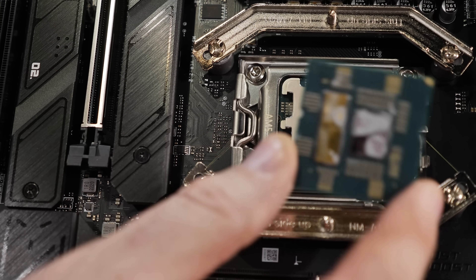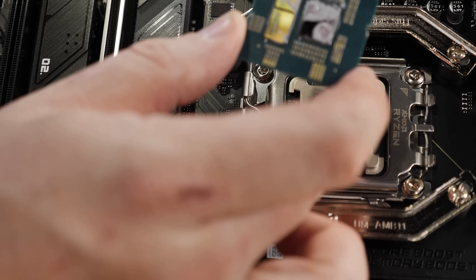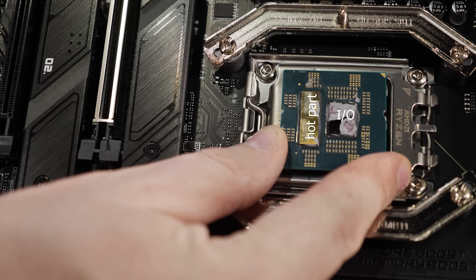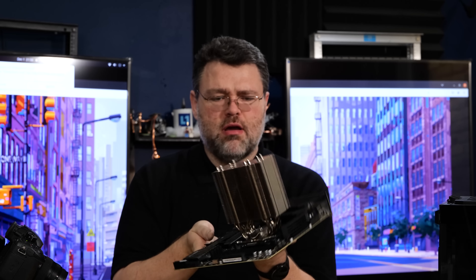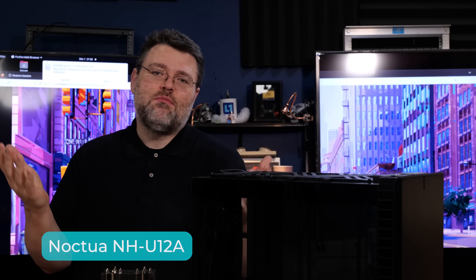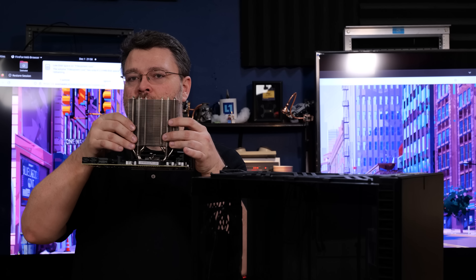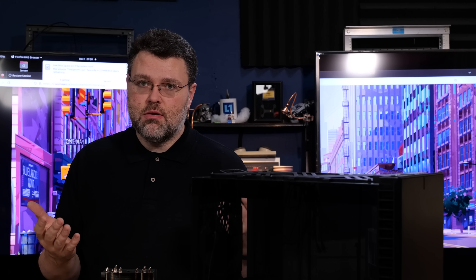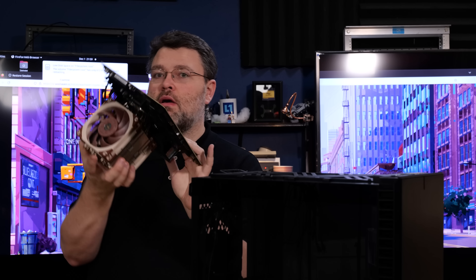You need to put thermal paste on your CPU. Under the heat spreader, the hot spots for the chips — you get the two chiplets and the IO die — that's where you want to make sure you get good coverage. This is what it looks like under the heat spreader: the parts that get hot are down at the bottom and then the IO die is in the middle. You might wonder about thermals: the 7900X is two chiplets and gets really hot, it reports the hot spot temperature. But this is maybe a one percent performance difference versus a 360 AIO. I'm not going to run PBO or any overclocking, so this will be fine.